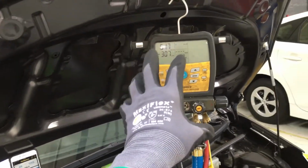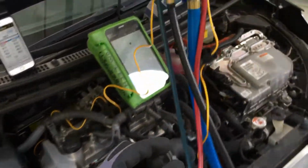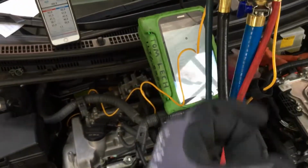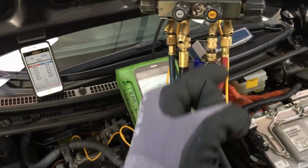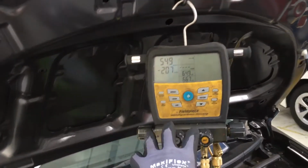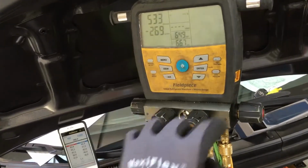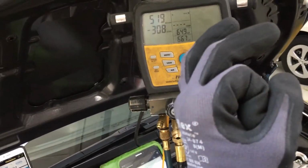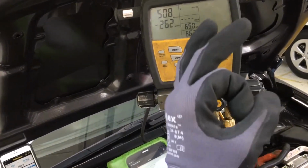But one thing HVAC guys from commercial refrigeration and residential HVAC don't understand: these are not normal valve cores that cause a lot of restriction. The size of these valve cores, their body, their diameter, the circumference of the valve when pressed open, instead of that little tiny taper core with the little surround opening, these things have like 8 times the amount of surface area. Kind of like the difference between the FieldPiece valve cores, with the stem and the seal and the opening inside and that big sealing surface area, and the Testo. The Testo has this little tiny valve plate, the little sealing nylon Teflon core for sealing and letting airflow across it, where the FieldPiece has a very large diameter circumference.